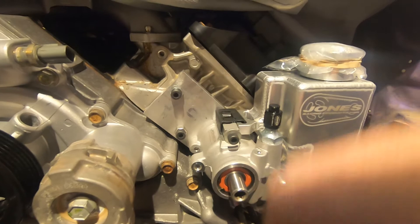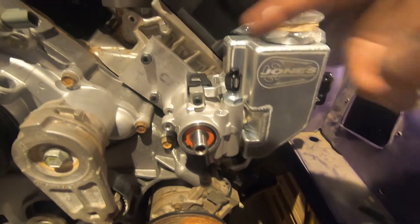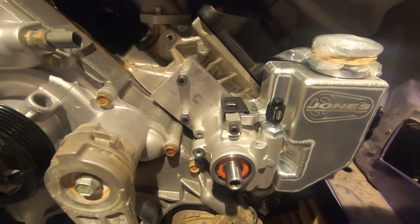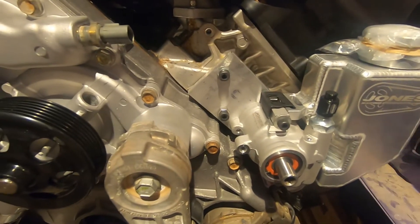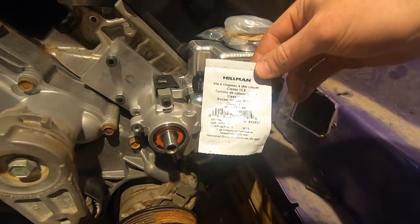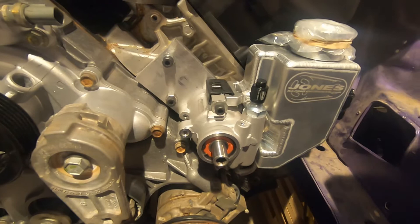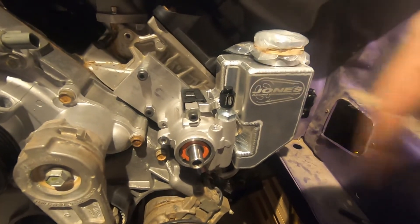And there it is mounted for the first time. As you can see, these two bolt holes aren't exactly in line with each other. This is a much more symmetrical design — bolts at 12, 6, and then 9. There's a nut on the back of the stud holding it there, and then I have two socket head cap screws affixing it to this plate — it's half-inch thick, so I think those threads will be just fine. I had alternator mounts on a race motor mounted very similarly and never had issues with threads pulling out. The only thing left is to clean up the shape a little bit. The cap screws for these — I had to use nuts on them. What you're looking for is M8 by 1.25 by 35 millimeters in length so that'll sit nice and flush. There is one more mounting hole behind this pump which I'll need to drill a counter bore in so the head goes down into the plate, because there's really no clearance on the backside. I might end up having to grind some of the head off, but it's behind the pump so you won't even see it.